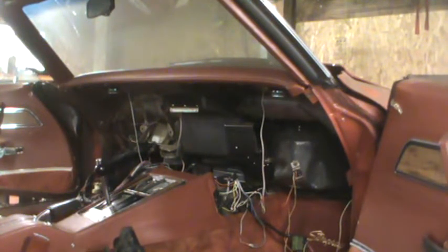Remove the evaporator and cover. So that, I think, can be done from the inside. Maybe I need to do that before I remove the part of it that's under the dash. Remove the original air conditioning harness and vacuum harness and throw them away. And install two plugs in the firewall. So I'm going to go under and see how much of that can actually be done.